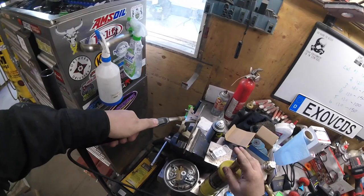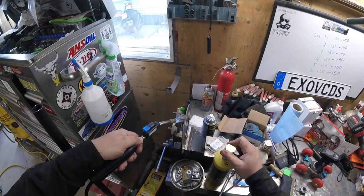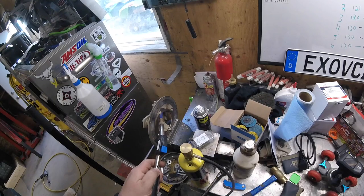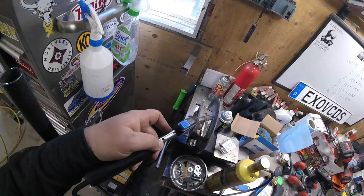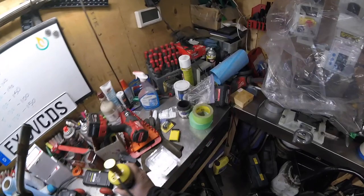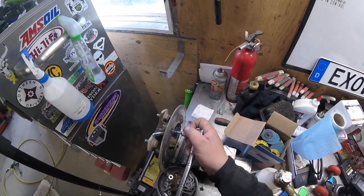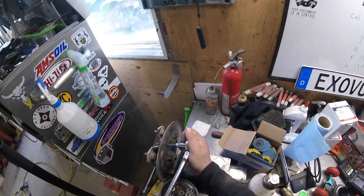So I found a rotor. Must be almost out of gas - anyways, I found a rotor so I've got to get the old one off. I've got to heat it up so the loctite becomes loose. The bottle's almost empty - spray some of this on there, spray the front. A little bit of heat goes a long way.